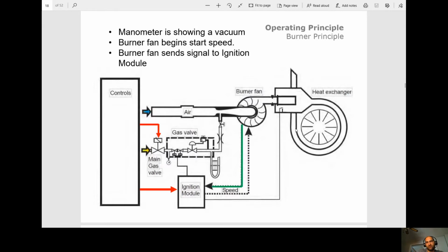The heat exchanger could have water in it. If it has water in it, it's going to slow down the speed of it moving air, and the negative pressure won't be as low as it should be. And then secondly, on the little blower wheel inside, if the fins have broken off, and I've seen that happen before, it's just spinning around in there. So you'll feel it spinning. So a good test to do at this point, obviously before ignition, is put your hand over the exhaust pipe right here and feel the airflow. If the airflow is feeling really low, there may be water in this heat exchanger.